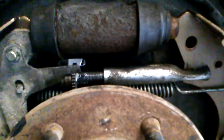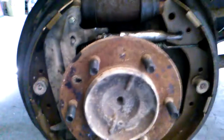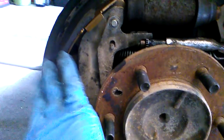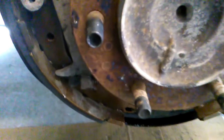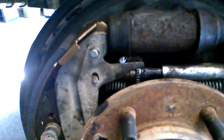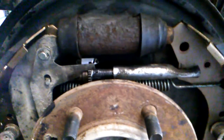Just to give you an idea of how the auto adjustment system works — in order to adjust the distance or gap between the brake shoe faces and the face of the brake drum on either side of the setup — just to simulate the application of the parking brake, and considering that there is an infinite gap at the moment between the parking shoes, the auto adjuster should try to compensate for this by spreading the pads.